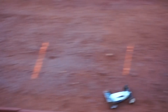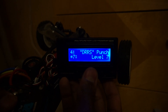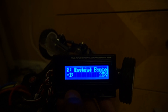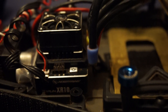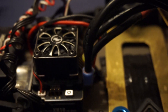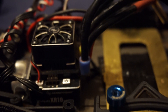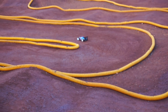Usually the most expensive part of your RC, the ESC is what controls the motor's power, its braking, and powers the receiver. Your ESC, much like your transmitter, has many different settings that unlike your transmitter, you might actually use — things like drag brake, neutral range, punch level, and other such settings to make driving a little bit easier. Now in stock racing, the ESC is put into blinky mode, which means no boost timing or turbo timing. It is legal in mod class though, so keep that in mind. There are many different types of ESCs out there, all with different amp ratings and brands. The amp rating basically denotes how powerful a motor the ESC can handle. For example, this Hobbywing V3 at 60 amps can handle anything down to 3.5 turns on 2-cell batteries. Make sure you consult your ESC manual to confirm what it's compatible with.